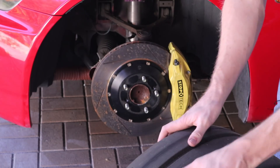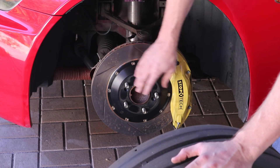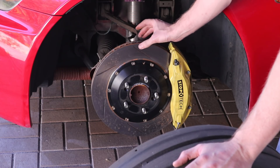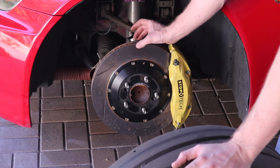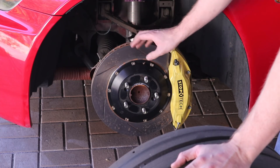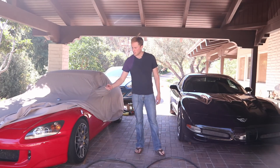So with this car I had to go with a big brake kit. In here I have some brake ducts — you can see them in there. I have these StopTech ST40 calipers and two-piece rotors from StopTech as well. These rotors increase the heat capacity significantly, because the stock S2000 brake rotors leave a lot to be desired. This big brake kit ran me $1,500.